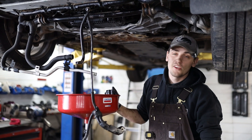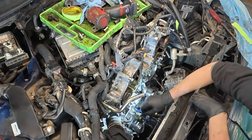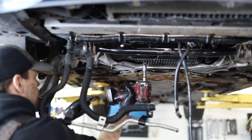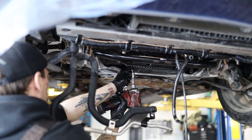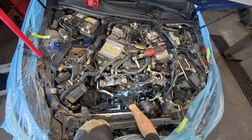All right, so we're back under the car now. We've got to take all these 10 mils off on the plastic oil pan, and we need to do that because there are a couple bolts that are holding the timing cover on right at the top, and once we get those out, then we should be able to pull off the timing cover. As you guys saw on the time lapse, I was pulling all the timing cover bolts out, so we should be ready to go soon.